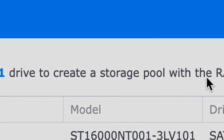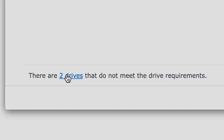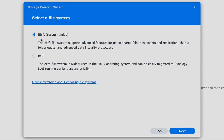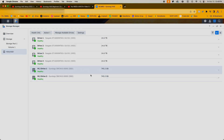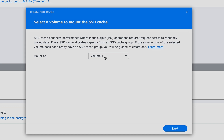For the setup process I was watching tutorials and bouncing back and forth — I'll link the most helpful ones in the description. I selected my drives to create a storage pool with a RAID type of SHR — 43 terabytes. The two NVMe SSDs showed as not meeting requirements for the pool, which we handle separately. I enabled data scrubbing every three months to keep things safe and healthy, then created the SSD cache. Everything is relatively intuitive and pretty painless to set up.